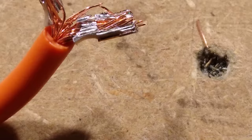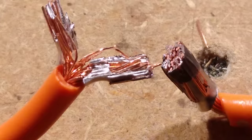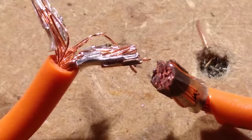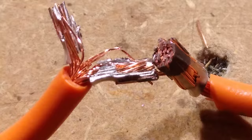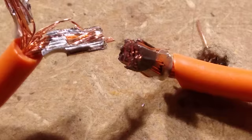Let's see how close I can get here - I'm working in a very small area right now. Looking up the end of the bar because I cut it in half, you can see the solder has bonded on the outside but it's not quite penetrated to the middle. When you split it in half you can see it hasn't penetrated right into the middle of the core. Maybe I didn't apply enough heat, or maybe there just wasn't really enough solder. I'm thinking maybe not enough solder, but ultimately it has bonded the outer conductors together and it looks as though it's flowed amongst them.